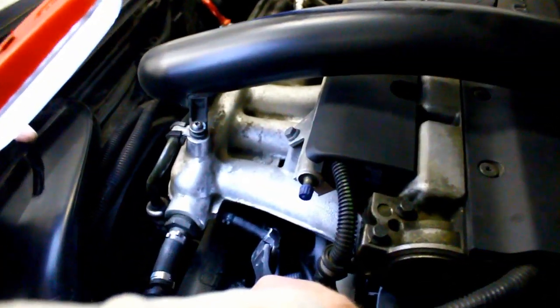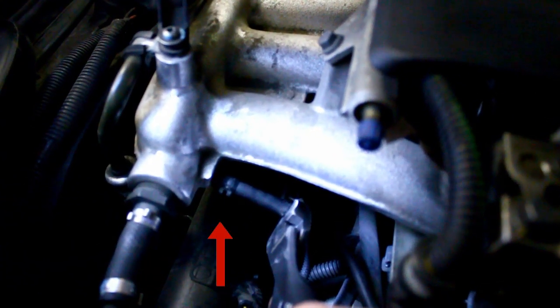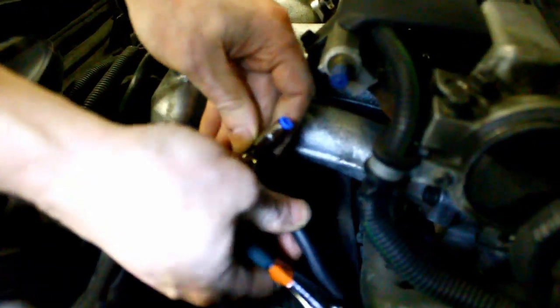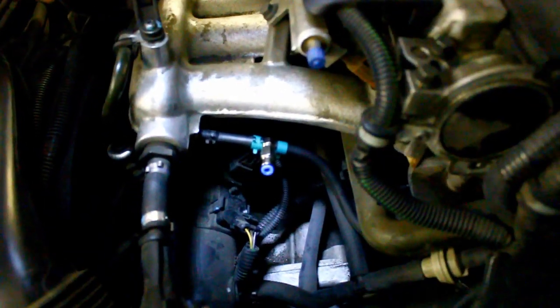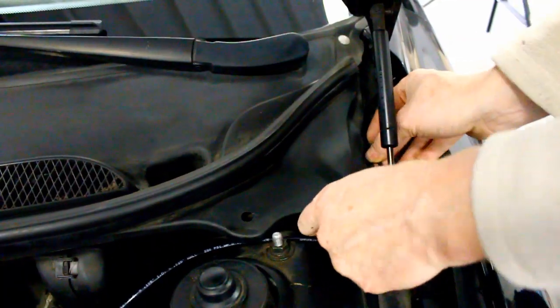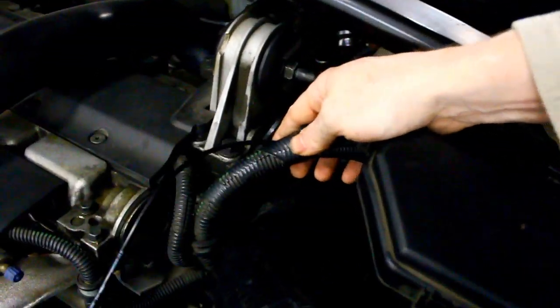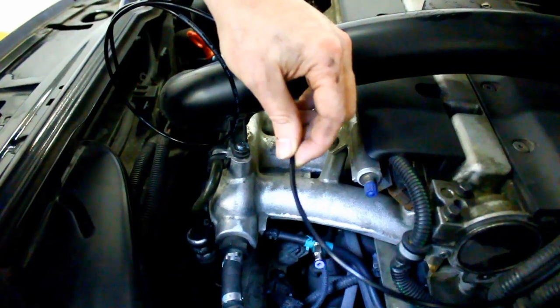The best boost source is the small hose at the rear end of the intake manifold. Simply cut the hose a couple inches back from the clamp, then install the supplied T-connection and hose clamps. There are multiple ways that the tube can be routed to the manifold — in this install, we are following the wire harness to protect the tube after install. Cut the excess tube and push the tube into the T-fitting.